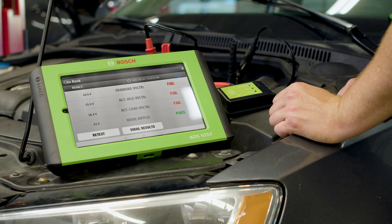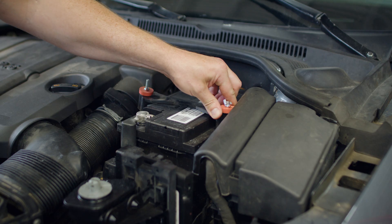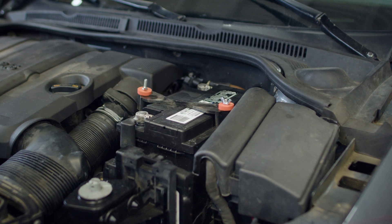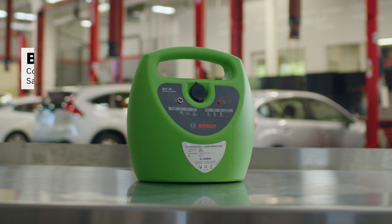The readings show a failed battery. A common mistake is to use rubber hold downs, which don't secure the battery in place. Over time, that movement allows the battery to vibrate and, in this case, likely killed the battery.